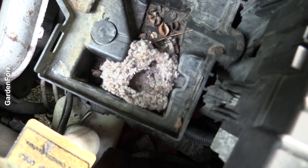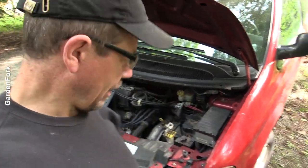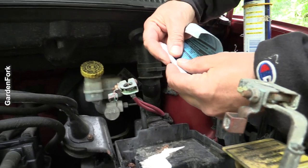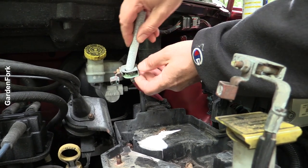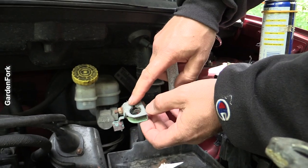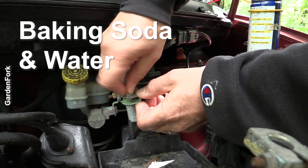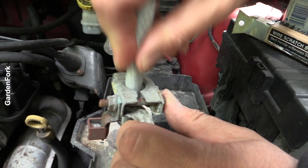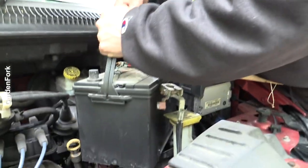Mice are living here — always a good thing. Battery is out of here. Take the battery down to your local auto supply store — I like to go to the local guy. If you don't bring the old one with you, you're going to get charged a core charge because they want the old battery back to recycle it, and it double-checks that you have the right battery. You can coil up a piece of sandpaper and clean off the insides of your terminals. If there's a bunch of puffy blue and white crud on them, wash with baking soda and water — or if they're in really poor condition, they should be replaced, as they might also be why your car isn't starting.